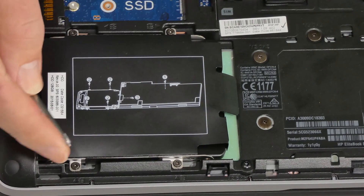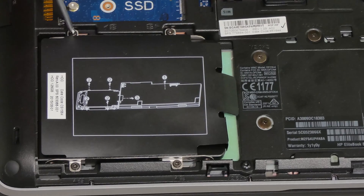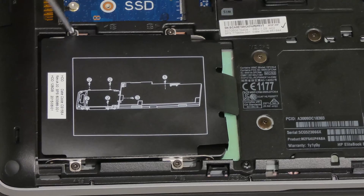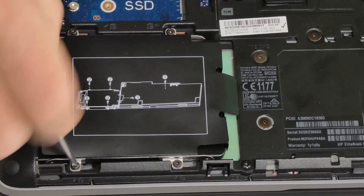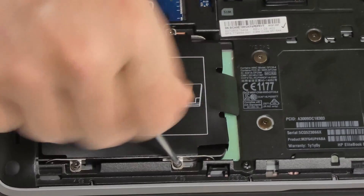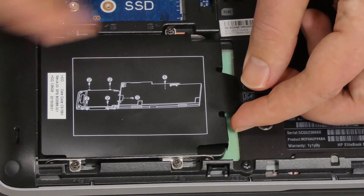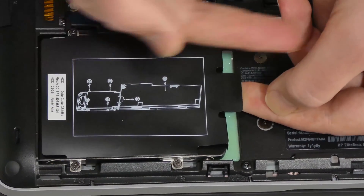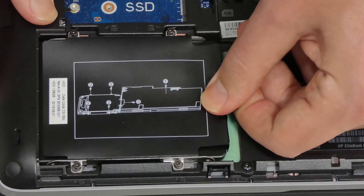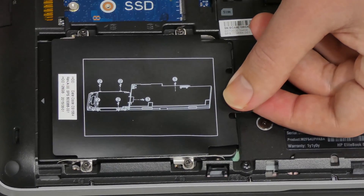Make sure you have a Phillips head screwdriver and then just unscrew all four screws. They have self-retaining springs so they're not going to fall out — just keep going carefully. Pull the drive bracket that way; similar to the battery, there's a little tab you can pull on to separate it. I put a little too much force on that, but you can see it separates like that.